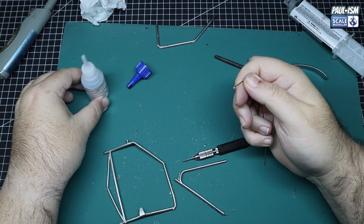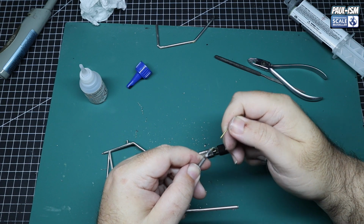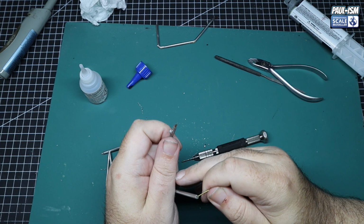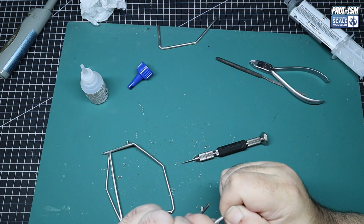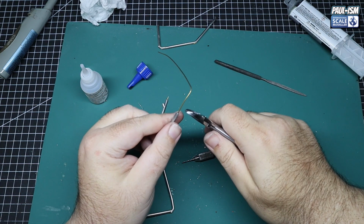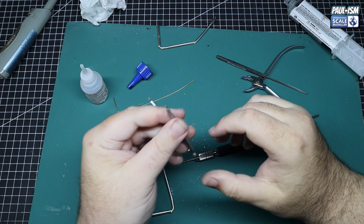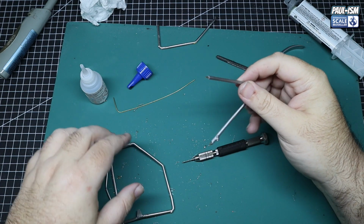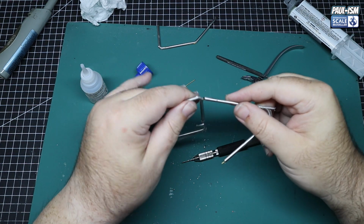I think low temperature soldering is the way to go. And I know Jamie, who built the other Lancia I've shown before on my videos, he soldered his, but he brazed it with a flame, probably some low temperature solder, and that would be the way to go. But I didn't have the solder. I didn't want to risk melting the roll cage again, having to wait another God knows how long for spare parts. So I've gone for this way.